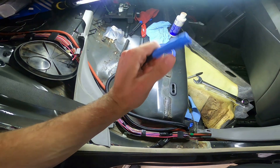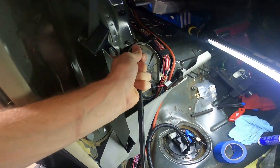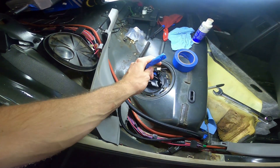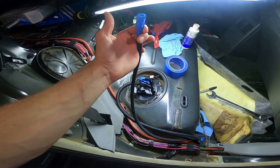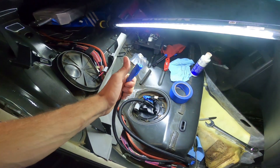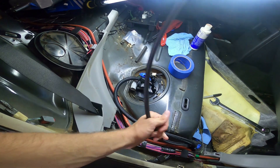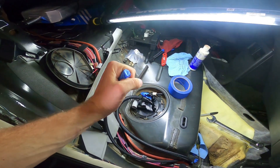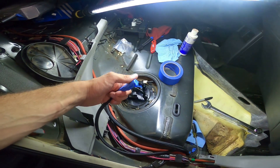So a little update: my local race shop said that this PTFE line hose, which has a plastic lining on the inside, is completely overkill. The fittings are more expensive, harder to install, and it overall just doesn't make much sense to use the dash six hose that I have. I'm going to go ahead and pull this. I bought some regular stuff from the race shop - it's the same style. I'll pull this out, replace it, and just work backwards. I'm really just here to learn.